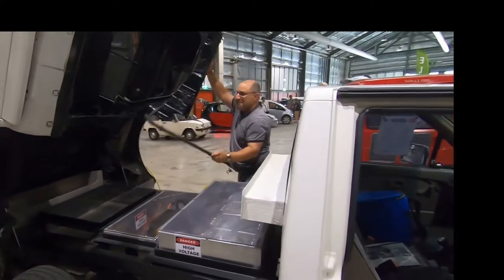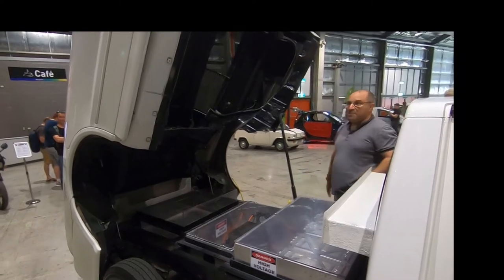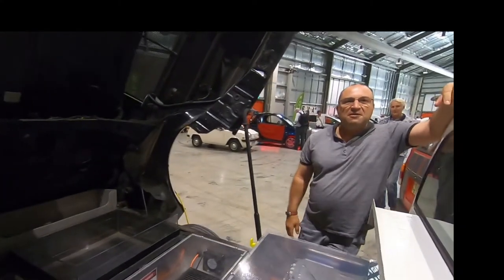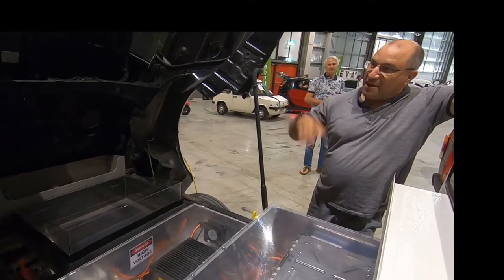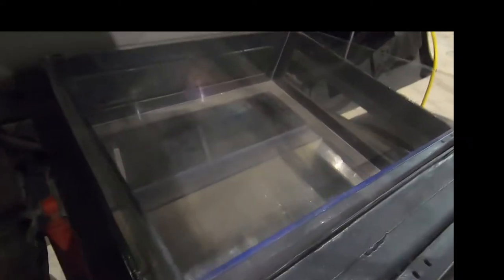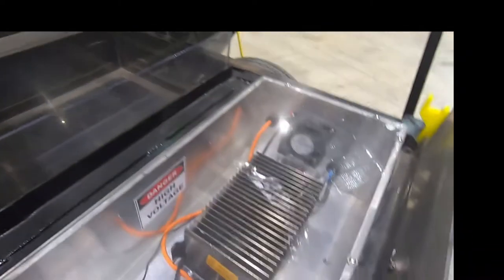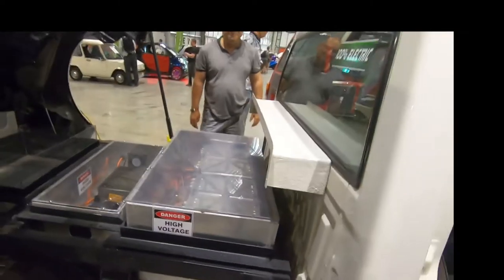Wow, that's quick. So the weight of the back on the hinges is about 20 kilos to lift it off. I've got the gas struts there, and that is the inside of a 2001 Magna. Look, you got some spare space here, mate. I've actually got some spare space. And you got somewhere to keep your belongings. And I'll keep the wife happy. I've got somewhere to put the shopping. That's the charger. Controller. Yep, charger and the 20 kilowatt Leaf batteries. Yeah, Leaf batteries. Awesome. This looks a great project.